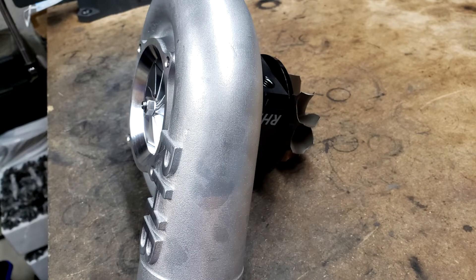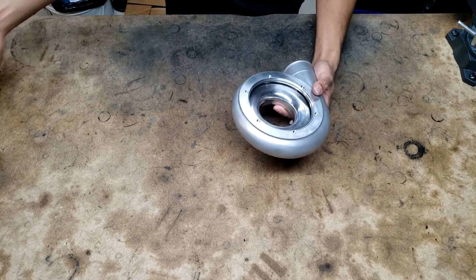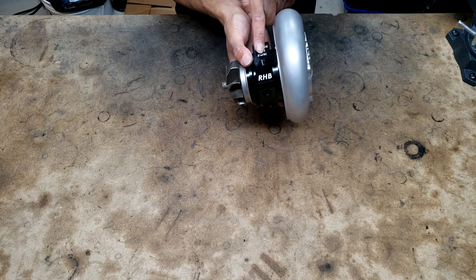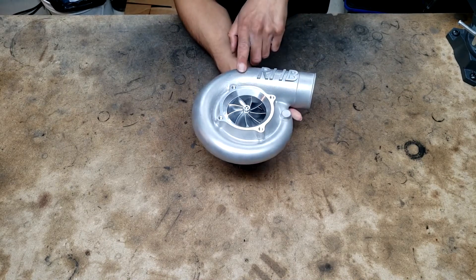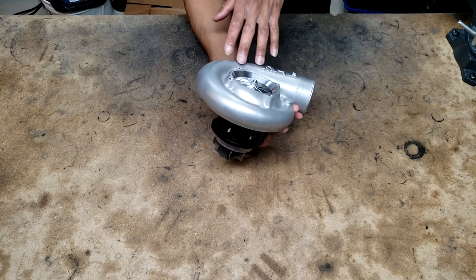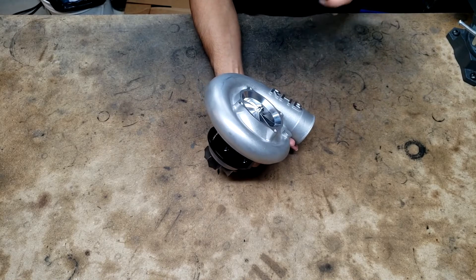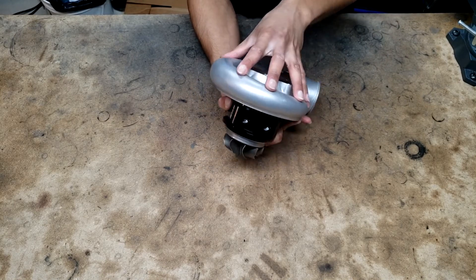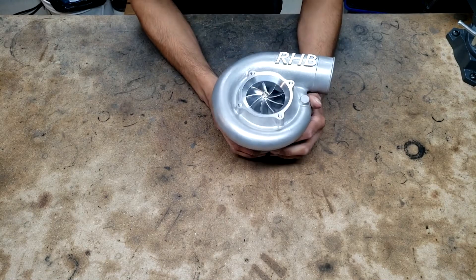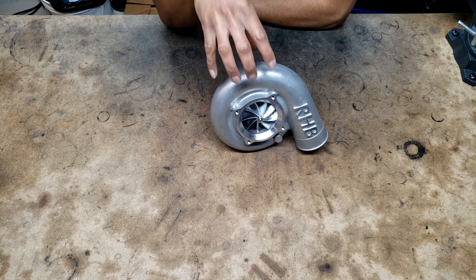This housing is also designed to be as slim and light as possible — obviously you don't want a heavy part on a race car. This particular housing is machined for the Super Six center section, which I run on the race car and many customers run. This is the same as what you get from our products site, except this new 3D printed compressor housing is 70 AR instead of 60 AR, which brings the Super Six's rated horsepower up from 700 — we'll see exactly how much once we test it.